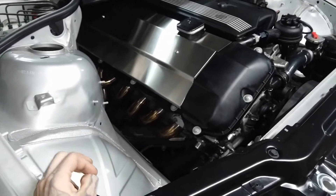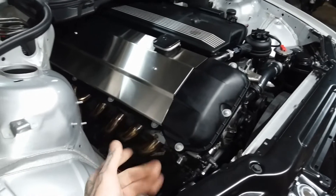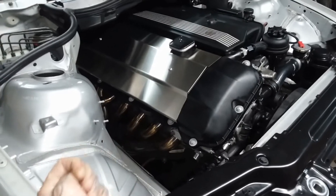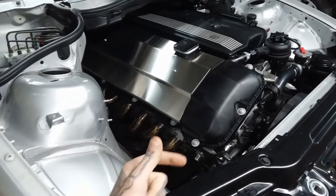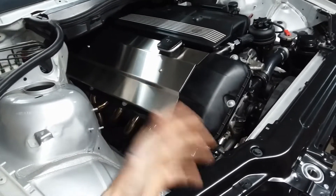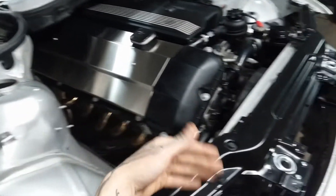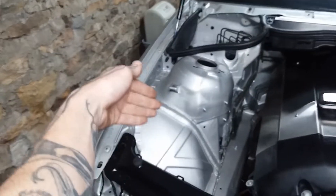I need to drop the oil pan again, which is going to be good for us because we're going to discuss the oil pump issues with these engines. Due to chain stretching, the oil pump nut will back off — especially more prominent on the 3.0 crankshaft due to the harmonic issues described earlier. A good thing to check is your crankshaft sprocket and oil pump sprocket and chain — replace those and you should be good for a long time. You can also add a chain tensioner. The engine bay has been repainted roughly a year and a half ago, and it still looks amazing.